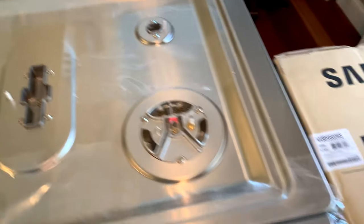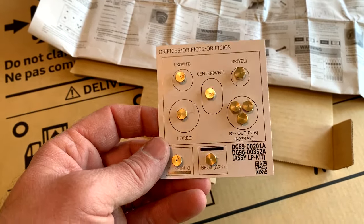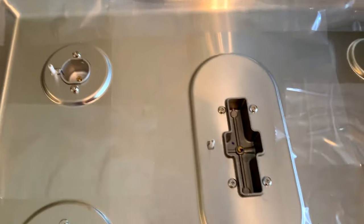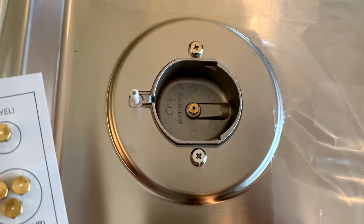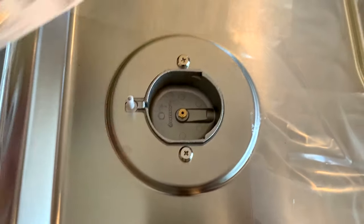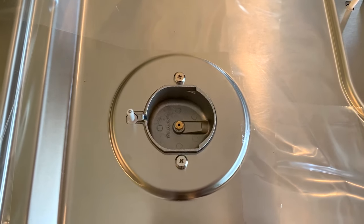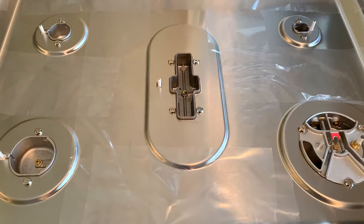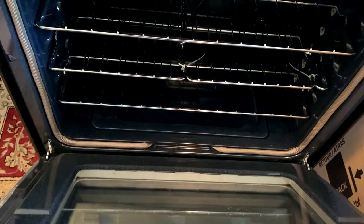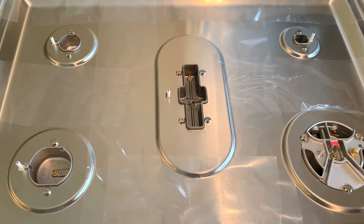To convert this there's a handful of things we need to do. First and foremost, it comes with different orifices. These orifices are the ones that get swapped out for the ones pre-installed for natural gas. The natural gas orifices are much larger than the LP ones. It is dangerous to run a natural gas setup on an LP system — the flame would be far too great. There's a two-step process: change out all the range top orifices plus two inside the oven (one for broil, one for bake), and also switch the regulator underneath the range.